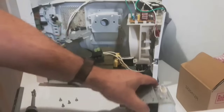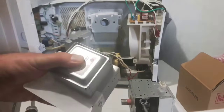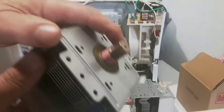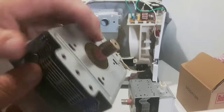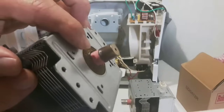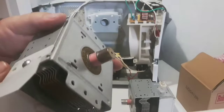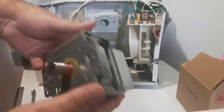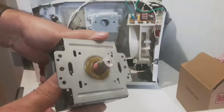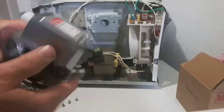On the video, one other person said when you check your magnetron, if the actual magnetron has got a different brown color and there's not much silver on it, then you've got a problem. Mine shows brown with only a little bit of silver — so maybe that's the problem. We're going to check it today. Here's the new one — there's plenty of silver on this one. We're going to put this one in and see.